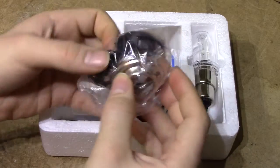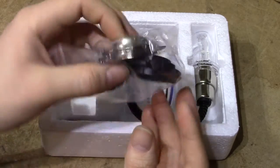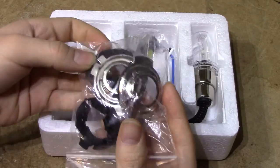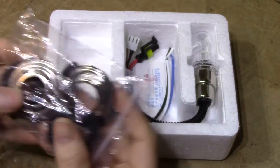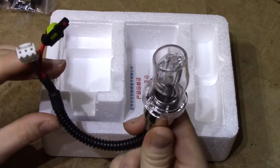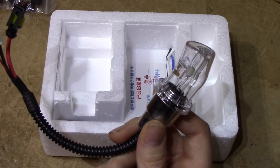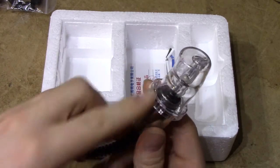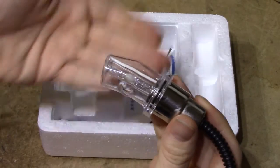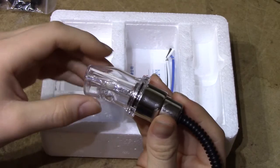Beyond that we get a bag of mounting hardware. I'm not certain what these would be used for, but I'm assuming they are used to adapt the bulb for different mounts for different kinds of bikes or land mounts. This looks like an H4 mount, which is not a very good thing in my opinion, since these xenon light bulbs are not capable of dimming to low beams like H4 bulbs should. The ballast does come with two output power levels, but these bulbs will shine light out in all directions at all times, whereas an H4 bulb has a reflector which limits the light output to a certain direction, making the light reflect down onto the road rather than up in everyone's faces.